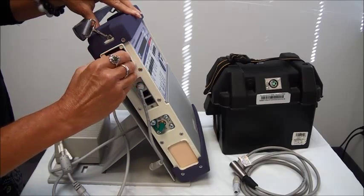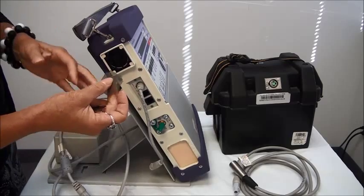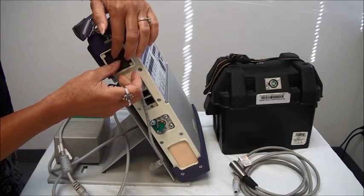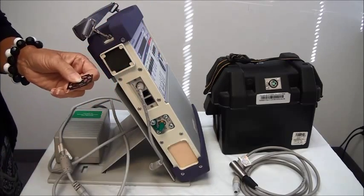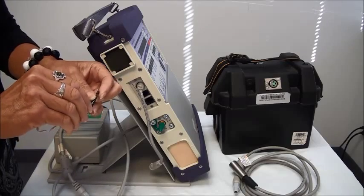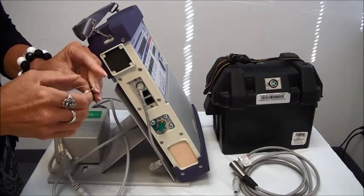You can just take your fingers and it'll pull out. Sometimes you've got to work at it a little bit, but it will come out. Then the filter needs to come out and it just needs to be rinsed out with warm water, air dried, and put back in. Now what some people will do to make this easier is they'll take a twist tie and work it through the cover, and then that will give you something to grab onto.